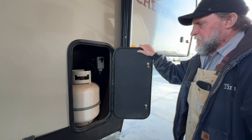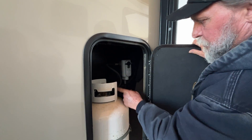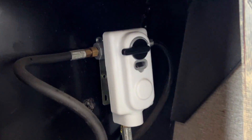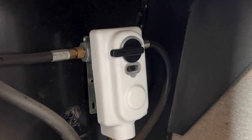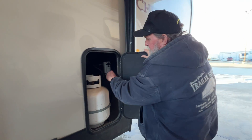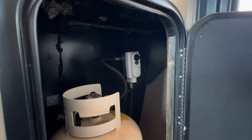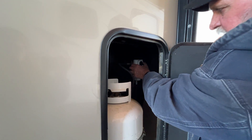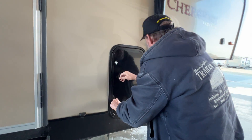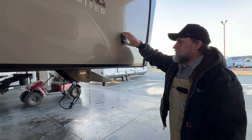On this side is your other 20-pound propane cylinder, which has your main regulator. The arrow is pointed towards this one — clear inside the eye. As soon as this tank happens to come empty, it's going to turn red inside the eye indicating that the bottle it's pointed to is empty. Then all you have to do is flip the arrow to the other side, work off that one while you take the empty one to town and have it refilled, then flip it back. One more thing on the outside: it does have a hookup for a solar panel.